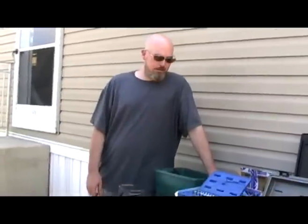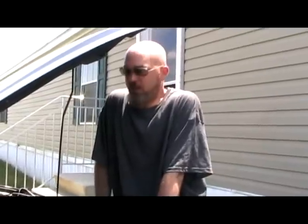So what did we learn today? Well, we learned that even with the high dollar GM scan tool, it doesn't tell you everything. It took having a lab scope to determine that we had a failing cam sensor. We learned that if you have a P0340 and you just throw a cam sensor at it, you're just changing parts. In my opinion, if you took your i6 Trailblazer to a shop and they charged you an hour's labor for diagnostics, just by plugging their code reader in and pulling up a P0340, they suck. You should never bring your car back to them, ever.